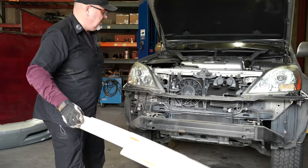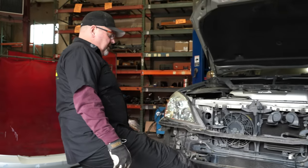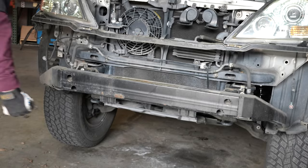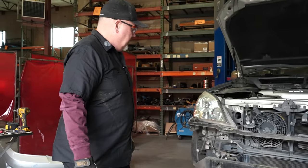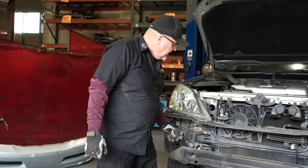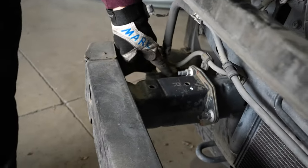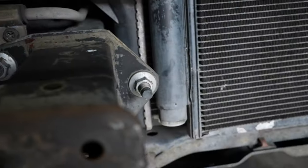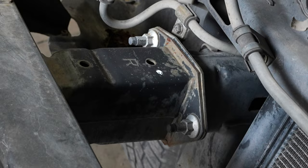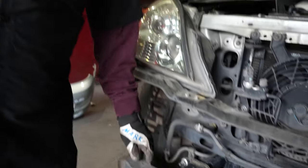There's foam in there — very important. Now we've got the crash bar. This is what the real bumper is on your truck — that's actually a legitimate bumper. We're going to take the crash bar off and then start putting our bumper on. You just have four bolts on each side on the frame, and when you take those four bolts off, the crash bar will come off. Don't be surprised if these are on there really tight — put a breaker bar on them and pop them off.